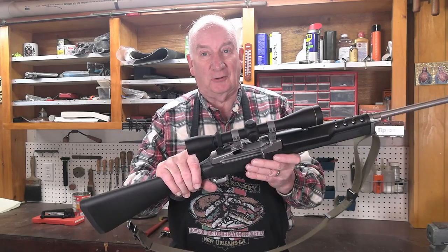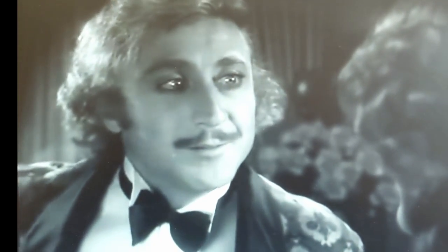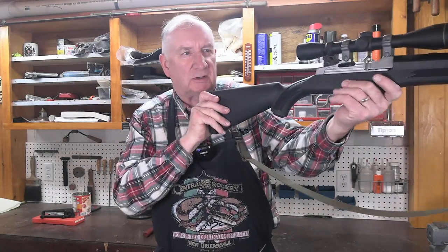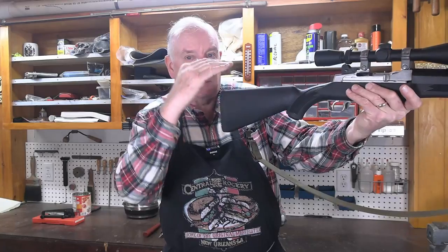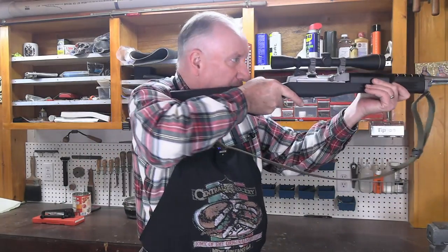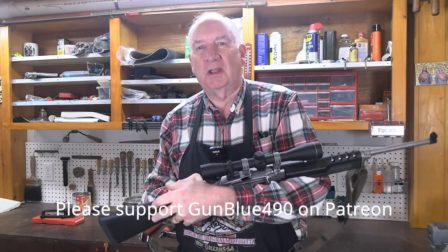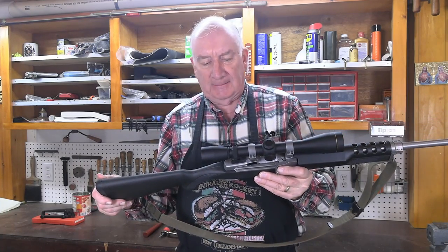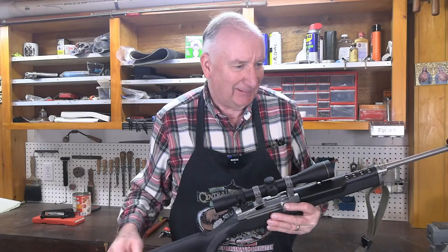Well, there we go — looks good, a little out of character for the handiness of this rifle. The crosshairs come up absolutely perfectly plumb and level. Some of the tricks you can use: simply look down the stock like this and you can see your crosshairs at a distance and tell if they're a little bit askew. Your eye is the perfect level — when you go outside and look down, I guarantee those are going to be straight. Thanks for watching; tune in on Patreon and support me if you can — it really would help a lot when it comes to purchasing ammo. Don't forget to hit that bell and subscribe, and God bless you. Ready to go Benny? Let's go to the range.